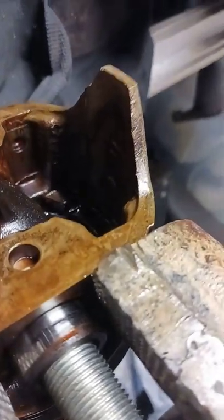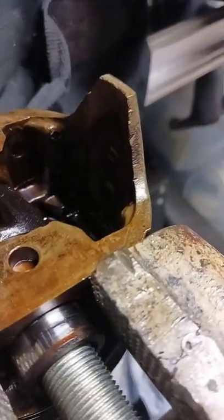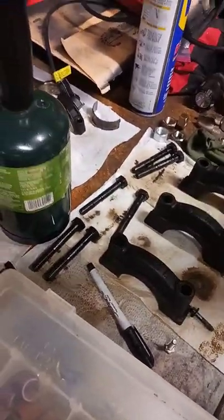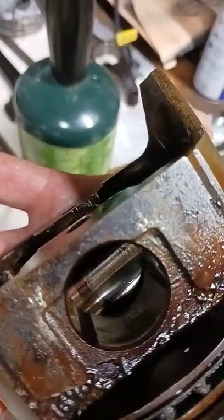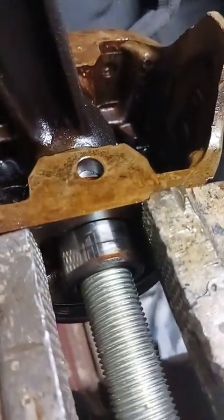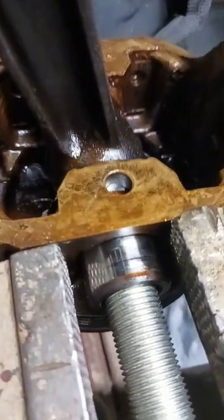Instead of pushing the pins out, it'll pull the pins out — just the opposite. If you put something soft on the outside of the device, you can put the piston right up against it without damaging the very edge. It does push a little bit, which you can see — those two shiny spots. Realistically it's not enough damage to do anything; the casting marks in these things are worse than what the vise puts on it. So if you wanted to skip putting something soft between a new piston and the vise, it really wouldn't make a huge difference. I'll take a picture of the tool when I'm done and see if I can edit it into the end of this video.